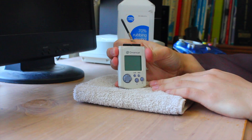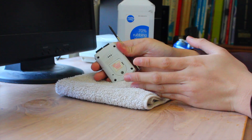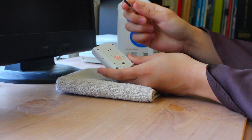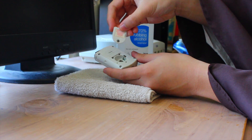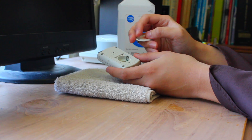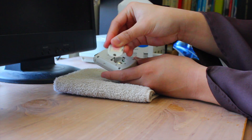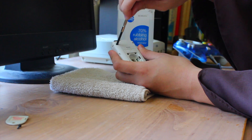All you need to do is take your VMU and flip it on the back. There are basically five screw points that you're going to need to unscrew: one screw for the battery compartment and four other screws in the corners of the VMU. Go ahead and take apart all those screw points with the bigger Phillips head screwdriver. I would recommend that you leave the screw of the battery compartment lid on the lid, because it's different from the four other screws on the back. Just set the lid to the side and work on unscrewing the other four screws.